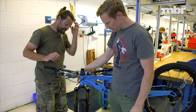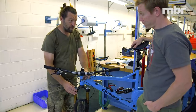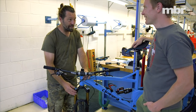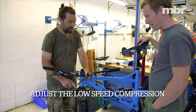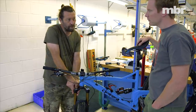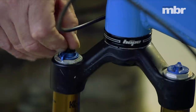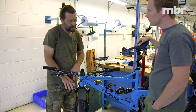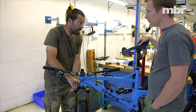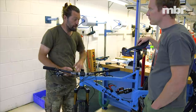The RC2 cartridges tend to work well at around 12 to 16 clicks. On this side of the fork we've got an adjuster that firms up the compression to hold the front end up for climbing — why anyone would ever want to do that I don't know. Why would you want the front end higher for climbing? Seems like a dumb idea to me. Then we've got a low speed compression adjuster. I would only use it if we were struggling to get the bike to use travel correctly and couldn't fix it with air pressure or volume spacers — then I'd wind some low speed compression on.